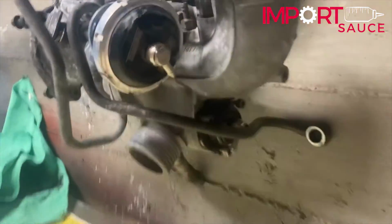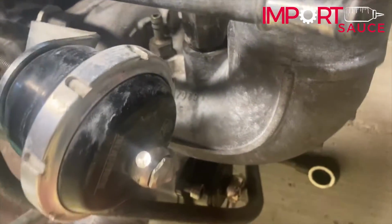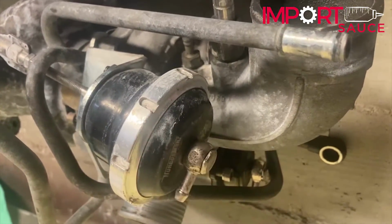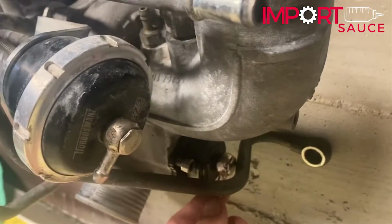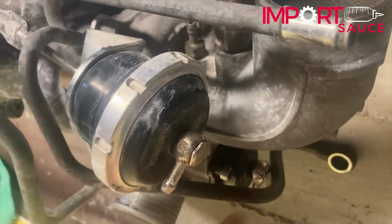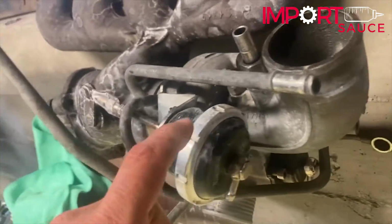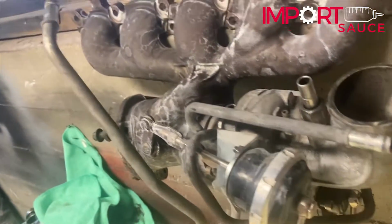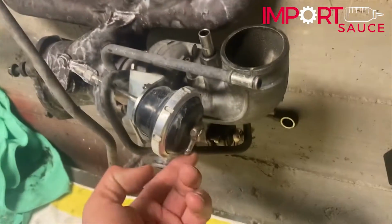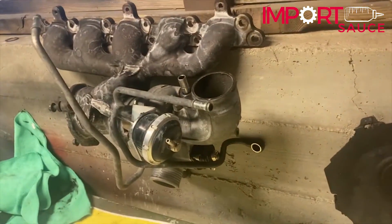The recirculation valve, we have the Elevate Turbo Smart one there, and I love how Elevate included these style ports for the vacuum line, because you can see here against that factory hardline oil feed in, it's essentially impossible to have the one that just sticks out straight. The other is the Elevate Spec Turbo Smart wastegate actuator on there. And same thing, it comes with that really nice spinny port, so you can get your hoses where you need them to be.